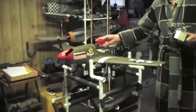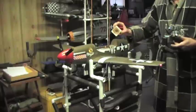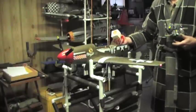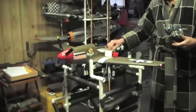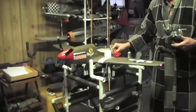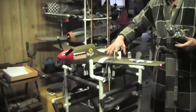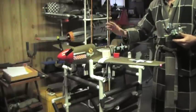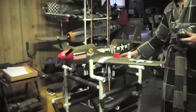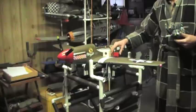mount mine in the particular application and in the foam, so I needed to pull a speaker out, and I actually made some custom wooden boxes in here. They're actually a little bit deeper, so there's a little more air volume at the back here for the air to resonate in, and I ported the back of it. I've also played around with putting tubes inside of here that give it some of that deep effect, and it fits really nice up in the airplane, just cutting a square hole and then gluing this up in there.